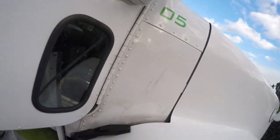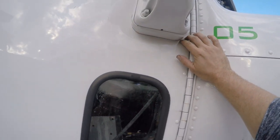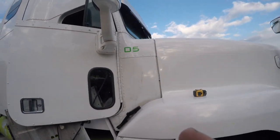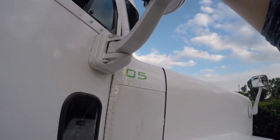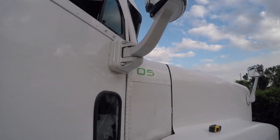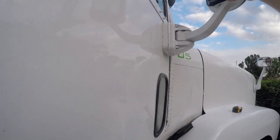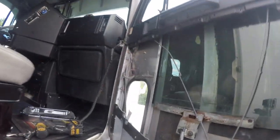Another suggestion: put the mount as close as you can to the edge of the door, because that helps it be more stiff — otherwise it's going to shake, and these mirrors are huge. I've had these mirrors on my truck for about four or five years; I was pretty much one of the first people who did this conversion. I bought them on eBay used — Miami Star didn't even have them for sale back then. I positioned them a little bit behind at first, but I moved them forward because the mirror was so big it covered the entire window.